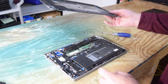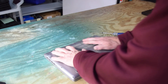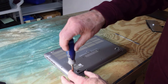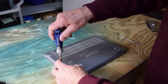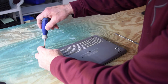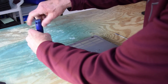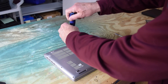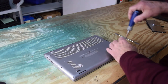Locate the bottom cover at the bottom and then push it down at the top — it'll snap, you'll hear those little plastic fingers snapping into place. Once you've got it into place, go ahead and reassemble the eight screws holding the bottom case on. I would highly recommend powering the laptop back up before you put the back on, just in case you didn't get something seated right — that way you don't have to completely take it apart again.